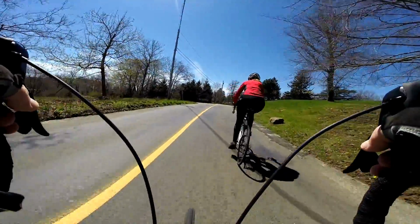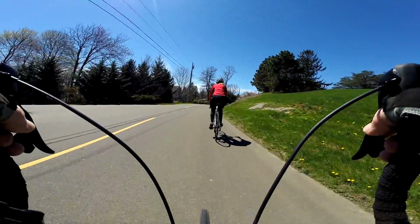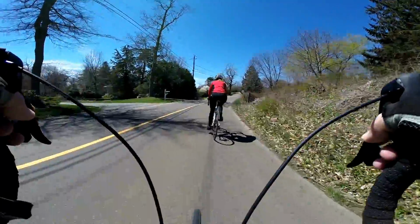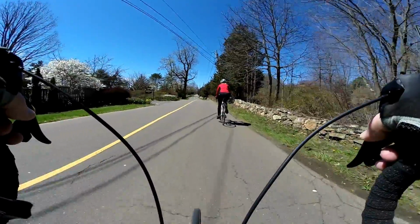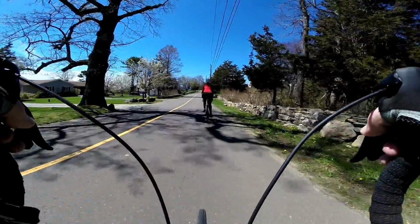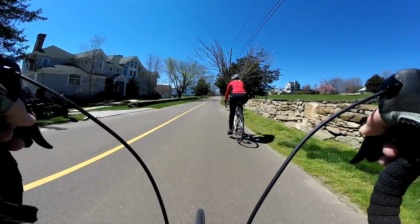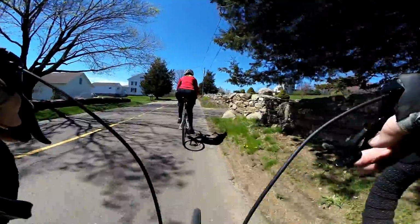And in fact, it did help me a lot with my riding position and my comfort level, but I did manage to get myself in a little bit of trouble, because by raising the bars up so much, I literally was stretching my brake and my shift cables to the point where I was affecting how the bike was shifting, and to some degree how well the brakes were working, but more importantly the shifting was getting thrown off a bit. The only reason I discovered this is that I tried as much as I could to adjust my shifting using the derailleur adjustment, and just could not get it to consistently give me a smooth shift.